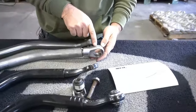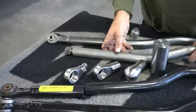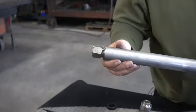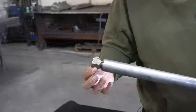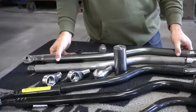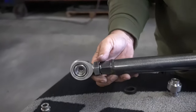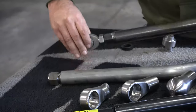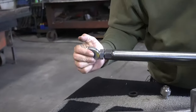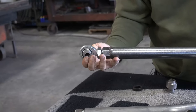Here's a good representation of what it looks like as we're building it. The chromoly end slides into the end of the tube — it's spot welded, and we bend it tight. On the other end, this is our tube insert for the 7/8-14 heim joint, which is how we get our adjustability. Then we weld it all up. The tube insert is welded in the end, and we have chromoly FK 7/8 with our own misalignment spacers that fit the stock JL/JT front track bar bracket.